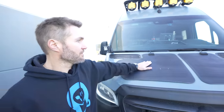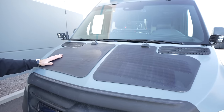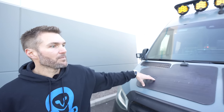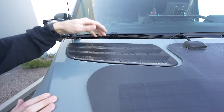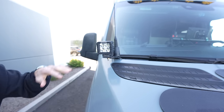These are solar panels on the hood — I just thought it was a good use of space. We don't make these, we get them from another company. For me this is really good because the van sits out here and doesn't get used as much, certainly in the winter, so this just keeps the chassis battery charged so that whenever you jump in you know it's going to start right up. These come on all factory Sprinters, but even in Northern California sun you can see this is kind of starting to melt — these things get hot and melt over time. We actually have a really cool product coming out for that, hopefully in the next few months, so stay tuned.